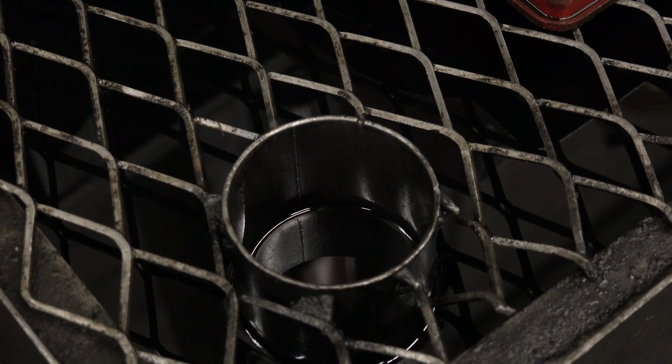We oil sample everything we change and send it off to make sure that there's no antifreeze in the oil, there's no fuel in the oil, you don't have a leaky air filter where you're dragging a lot of dirt in, you're getting a lot of carbon and stuff down there. So that's pretty important, because the oil change is way cheaper than building your engine.